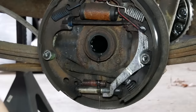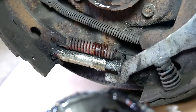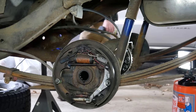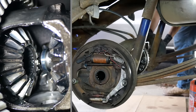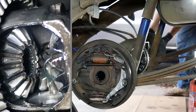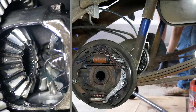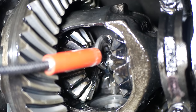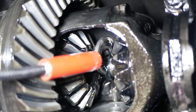Be prepared for the oily mess. Before putting things back together, we'll have to carefully clean up the insides of our brake drum assemblies to make sure that the gear oil doesn't get on our braking surfaces. And once we chase the dog away from the gear oil, we can repeat this process on the other side. Axle shaft gets pushed in, C-clip gets removed, axle shaft gets pulled out. With how easy it is to remove these axle shafts, it's pretty obvious why C-clip eliminator kits are so popular and at a lot of drag strips required as a safety upgrade. But today we'll just be reusing the C-clips because for our use in this vehicle, I think we'll be okay.